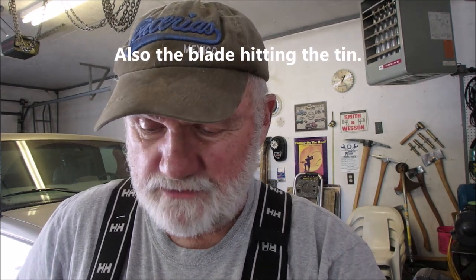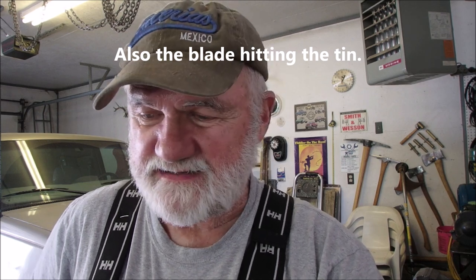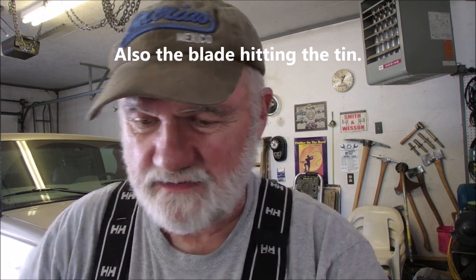So anyway, thanks for watching. You know, it was a tough one. The wheel alignment was by Armstrong method, and the flywheel key was a bit sheared, not totally, and that helped a lot. And I ran it for 5 minutes, and the knock went away. But it could be part of the timing issue. It could be settling in, you know, a nice oil change. The old oil could have been as thin as gas. Who knows, right? I just dumped it into my 5-gallon waste pail. So there we go. Got another one done. Thank goodness. Talk to you guys later.